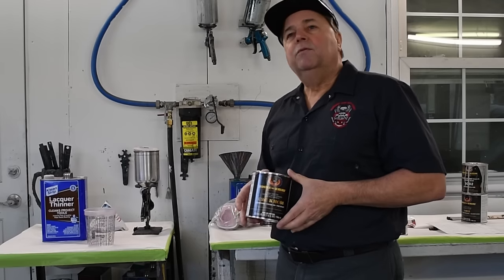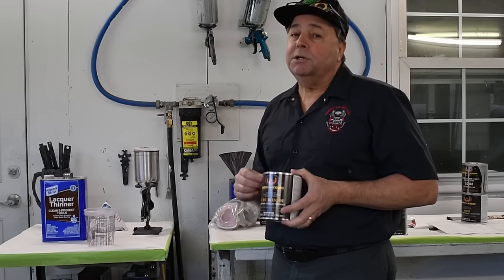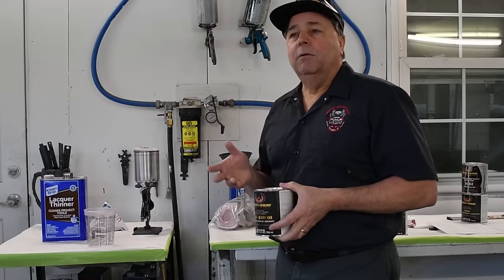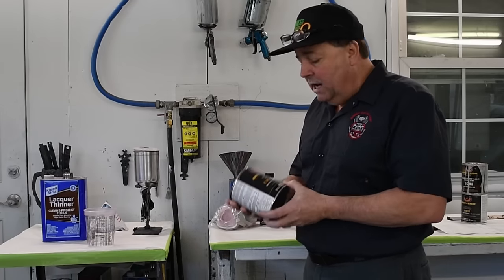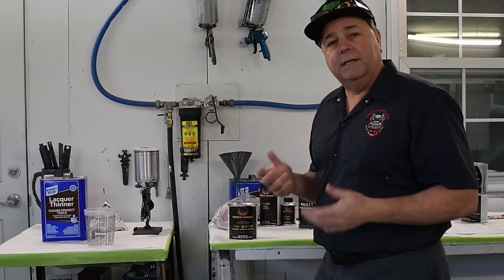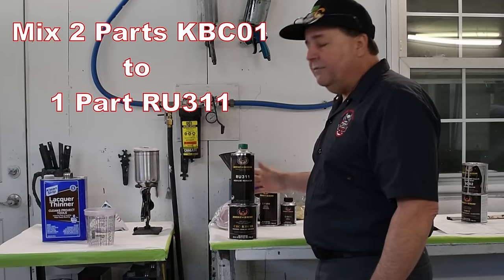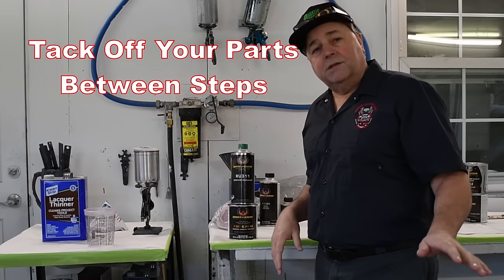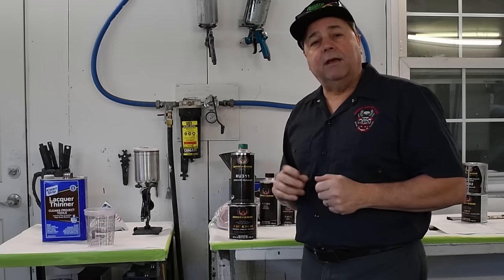So if you've got something that you're worried about, you might get a scratch or a chip and you might want to re-repair that, I would recommend the KBC. It's just easier. So anyways, we've got KBC 01, and we're going to mix this the same way we mixed our Orion Silver. We're going to use two parts of that and one part of the RU311. We'll mix that up, tack down our Orion Silver, make sure all of our dust is off of that, and we'll go ahead and apply the KBC.